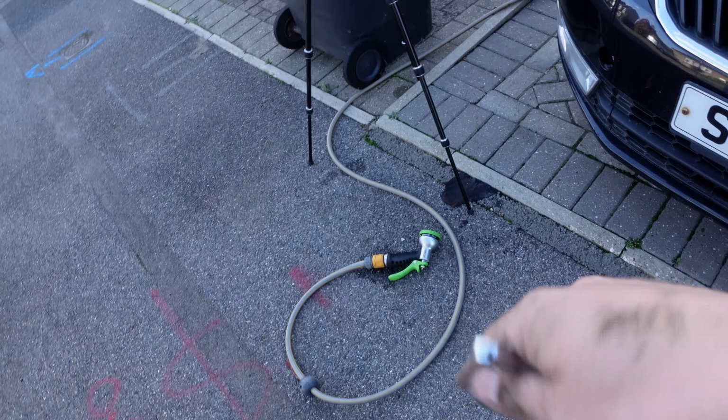All right, guys, it's a new day. Last night, I let the clear coat on the bottom of the bonnet dry. Now I've flipped it over, I've remasked it, I've sanded down any little imperfections, and now I'm just gonna tack cloth it and put the base coat down. So hopefully in the next couple of hours, the bonnet is gonna be completely done and ready to go back in the car.